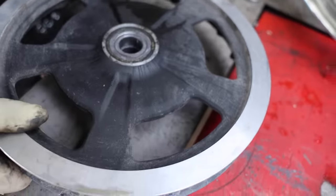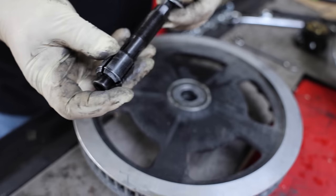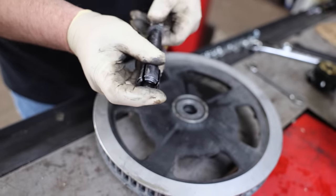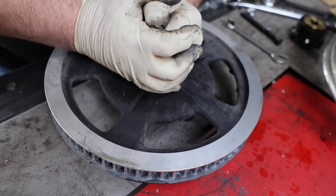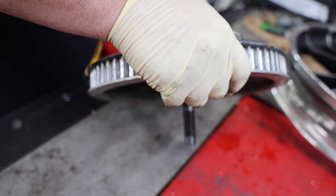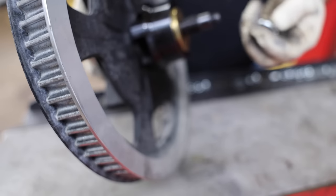Now let me show you guys what Nick's going to do. You've got to pick the right size — in this case it's one inch. There's a lip on the tool that goes in here and actually spreads open, tightens up, and makes sure it doesn't pop off. Once it puts pressure on it, it expands the inside. No good to just bang them out — you've got a much better chance of damaging the bearing that way. It just catches the edge of the bearing on the inside, puts pressure on it, and then this cup here sits on the outside so you can pull the bearing through. Sweet tool.